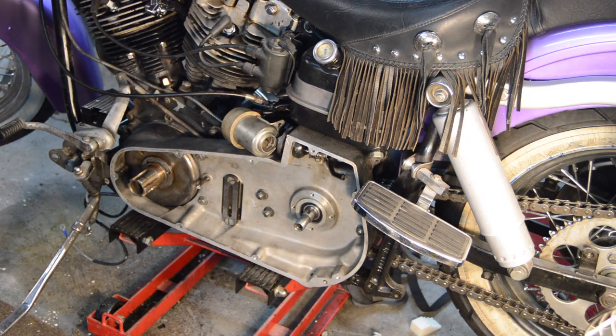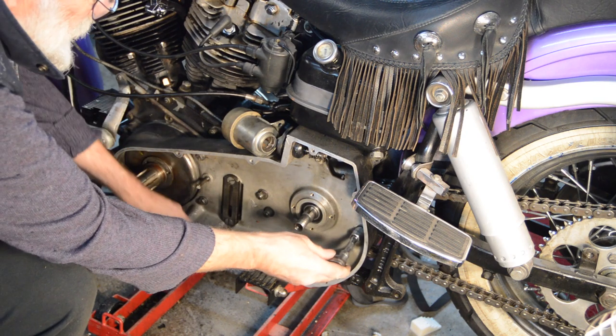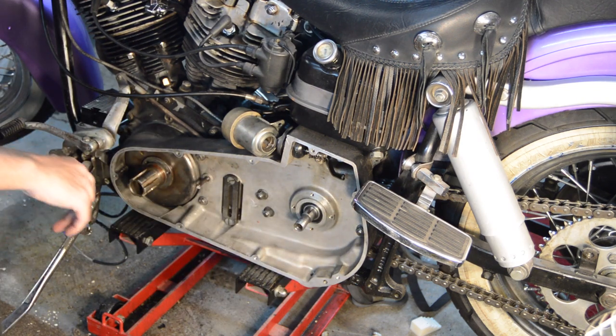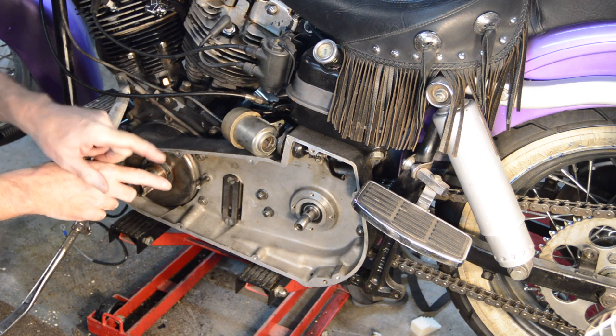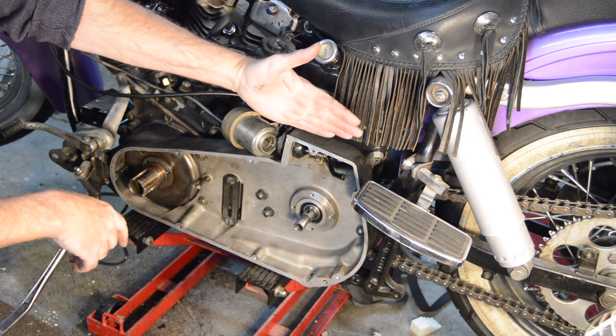Right, I've taken all the bolts down very, very carefully, moving from one to the other to make sure I'm not putting any strain on the case. And then they're all torqued up to the setting in the workshop manual, which was 18 to 24 pounds, I think. And I made sure that that still turns freely, which it does. So really, I think we can move on to fitting the starter motor and things, which I can't show you because you've got to go in from that side and it is only two bolts. I'll put the plate washer behind with the seal in.